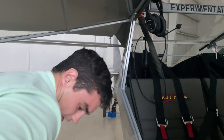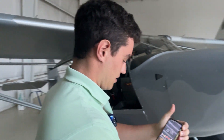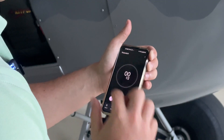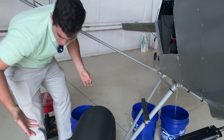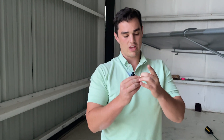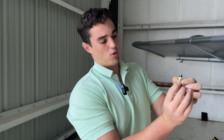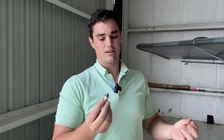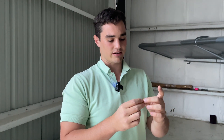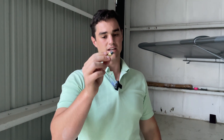We're going to start the timer now — there's nothing we can do about it at this point. I'll put a timer on and see actually how long it takes to drain the tanks. We just spilled fuel everywhere, basically. This was something I was actually concerned about because of the way that valve is on the header tank — it's sort of inset in a little aluminum cup, almost the same diameter as this particular quick drain lock. This model won't work; there are some other options out there that are a little narrower. I'll have to go back to Aircraft Spruce and buy a different one.